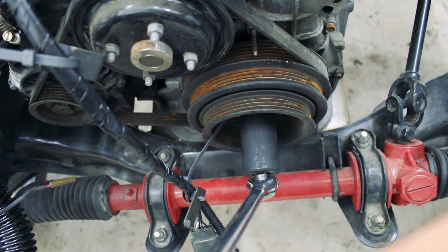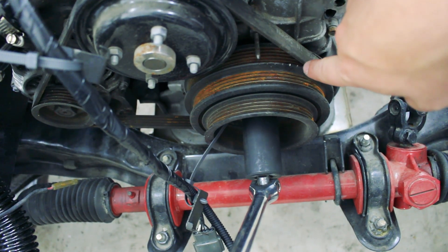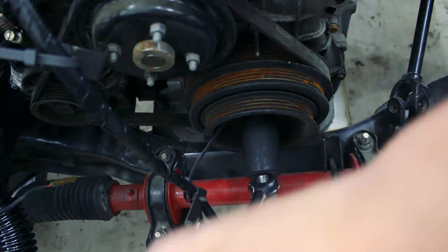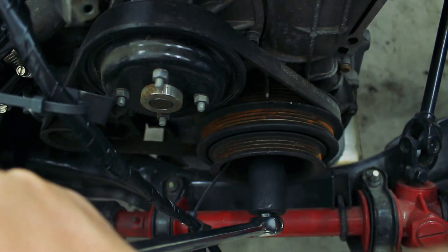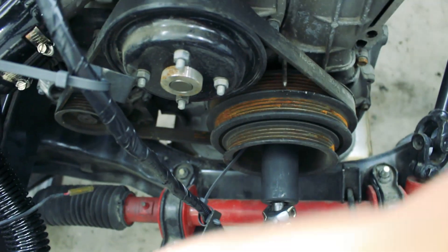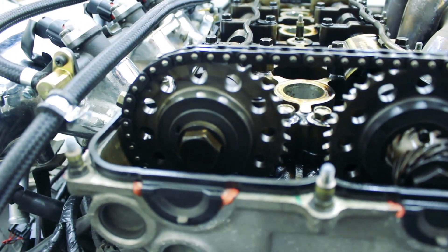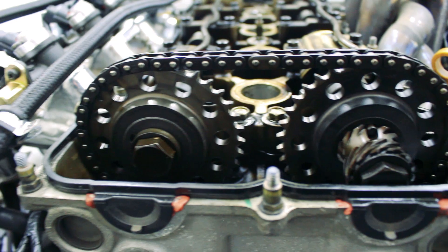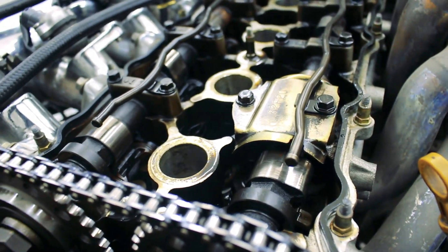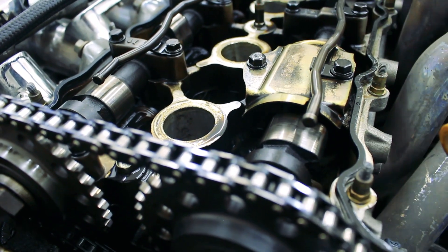These are usually covered with dirt and obscured from view, so you may have to clean them up to make them more visible. In my experience, I had to use the second mark in from the left, though I have heard people say contrary points — perhaps it's different on other SR engines. When I was attempting to align this CAS, I had to use one mark in from the left to get it to where I needed to be. If you do this incorrectly, the engine will not start as it will cause the CAS to be out of position for the firing sequence. It should not cause permanent damage, but you'll have to redo the work to get it realigned. As you can see, I achieved the magic cam lobe alignment with them both pointed to the outside, so I'm pretty close.